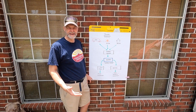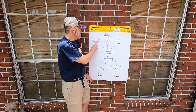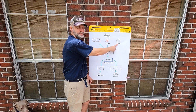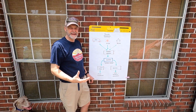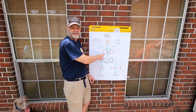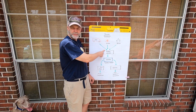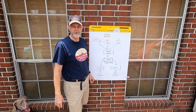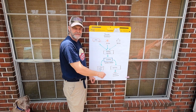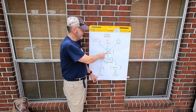First thing you have to do is energy has to be produced somehow. Beverly has the option to take advantage of three sources: she's got the alternator in the van, she's got solar, and she's got house power when she's mooch docking. So we can take power three different ways. To combine it, we went online and found that the Renogy DC-to-DC charger does a very good job of that.